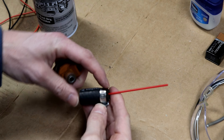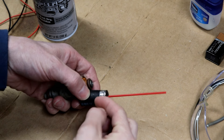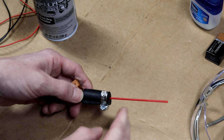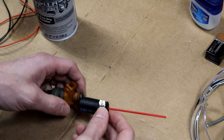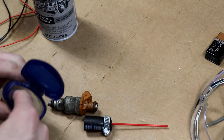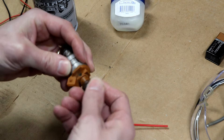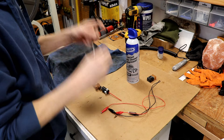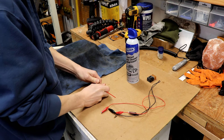The reason we're keeping our fuel line short is we don't want a lot of free space in there. We want the rubber stopper right down to about the end, and we're going to slip this over the tip so we don't fill up a bunch of the fuel line with cleaner — just a short little space is best. Just a little bit of petroleum jelly on the O-ring here helps us slide it on and off. Let's get our safety goggles on and slip our little rubber tubing onto our fuel injector.